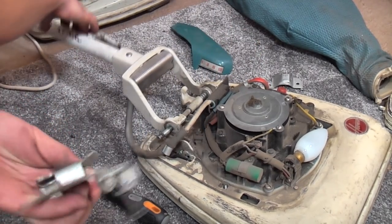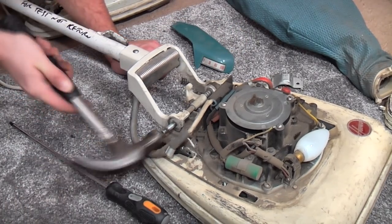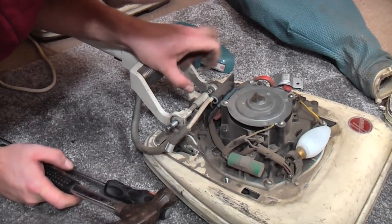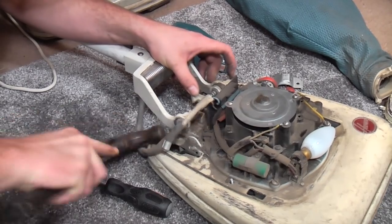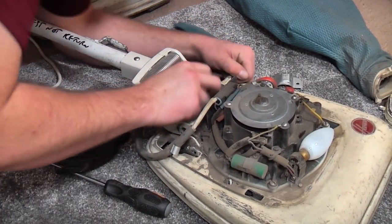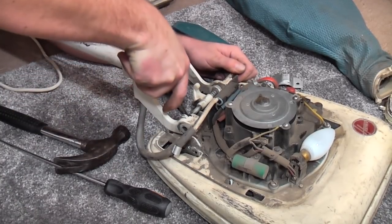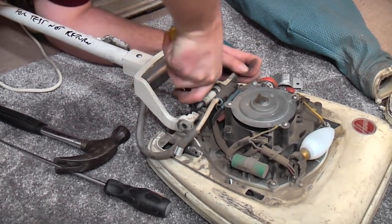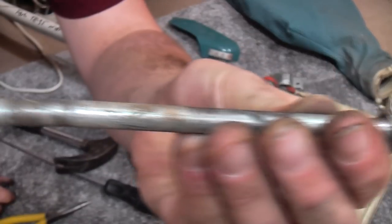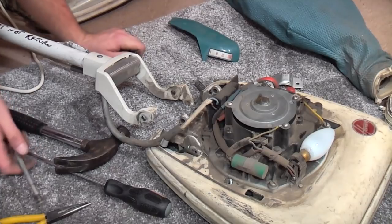So this is the release, okay, that's now floppy, because this is the part that locks it in. Now it's just a case of hammering it. Really. There's no other circlips, but we've now got to try and force it. It just needs to be forced into line. There we go. That's what made the bag so difficult to get on and off, because that was rusted. So that is a very bent axle. There you go. That whole thing is now loose. The whole thing is disgusting.